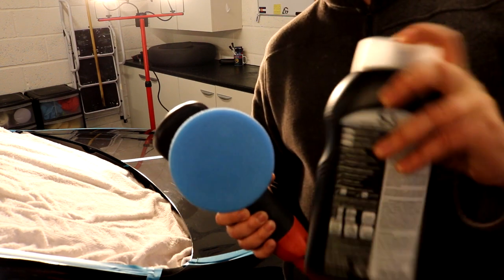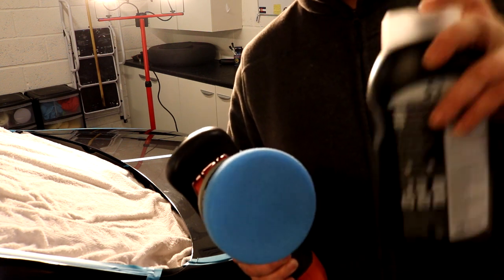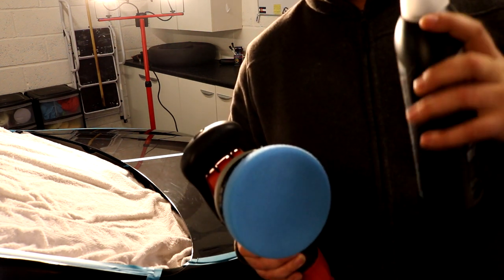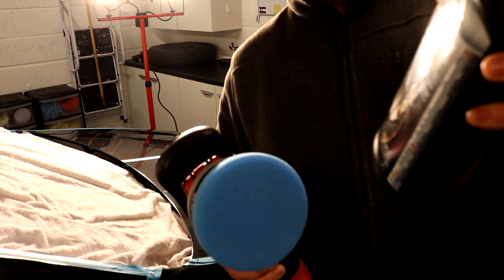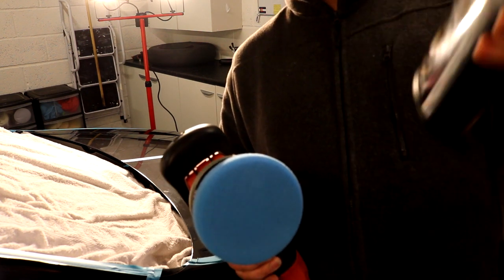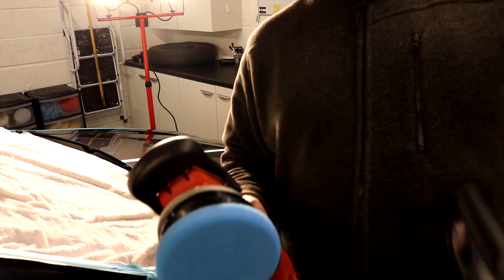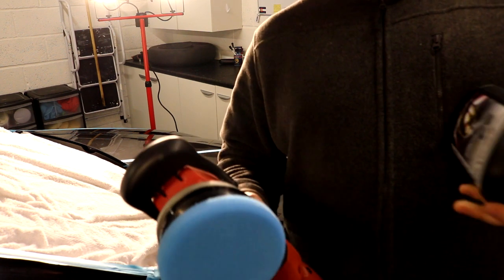The second thing is this compound needs to be shaken up. All the abrasives in it, if you could hold them in your hand, they'd look like talcum powder, are mixed in with lubricants, but the way they're mixed in that bottle, where that bottle's just been sitting there, isn't going to be uniform. So you want to shake the bottle really well. Okay, that will do.